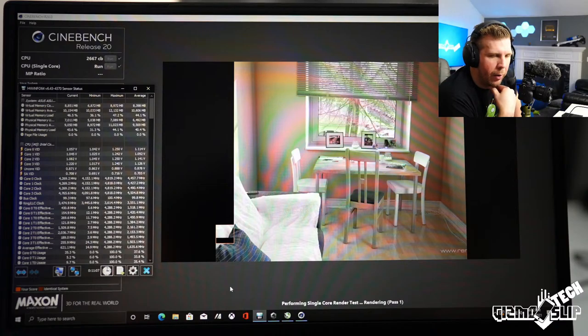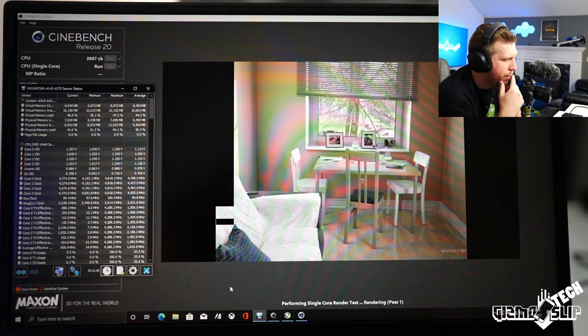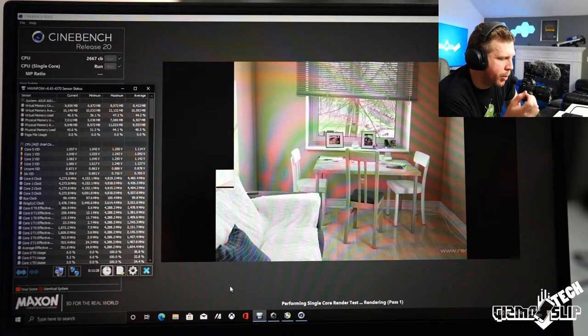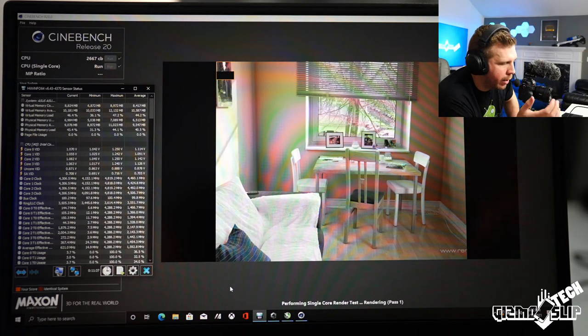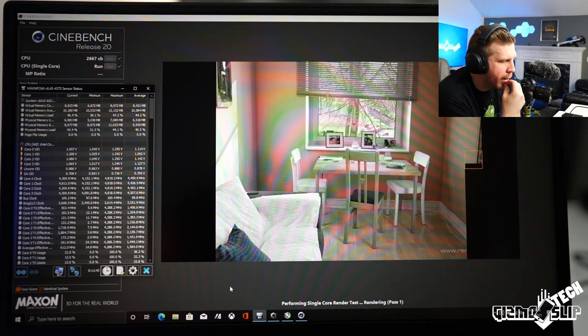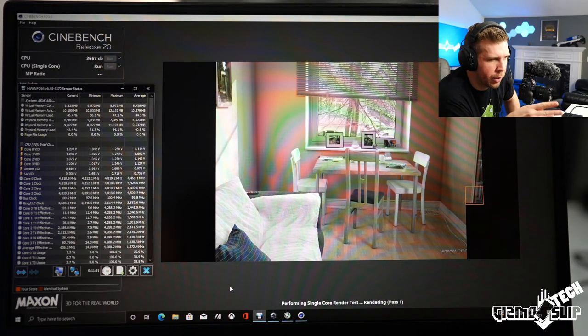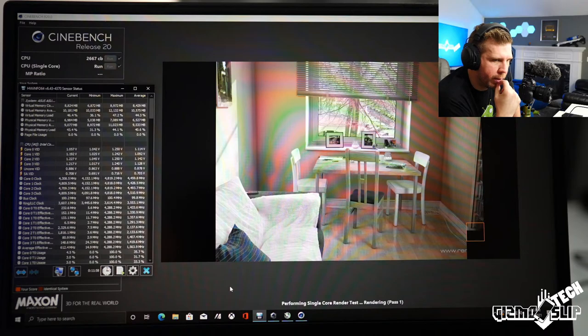That's weird. I would encourage you to pull up something like HW Info, maybe your MSI Afterburner. You can do the overlay like I just set up a few minutes ago, and you can see what's going on with your system. Because if you're running into lots of throttling and bottlenecking in gameplay, it's probably because your CPU or your GPU is being power limited. Maybe something is thermally throttling a lot, so maybe your GPU or your CPU is really overheating. Maybe you need a driver update, so I would encourage you to update your drivers. I would encourage you to clean out your fans. And if none of those work, I would encourage you to restart your machine as well. That's one of the easiest things that can fix low performance glitching.